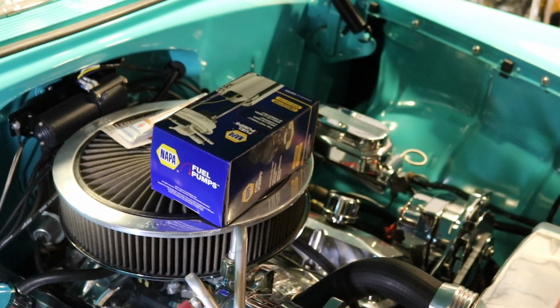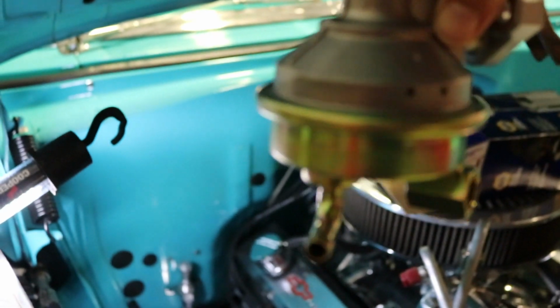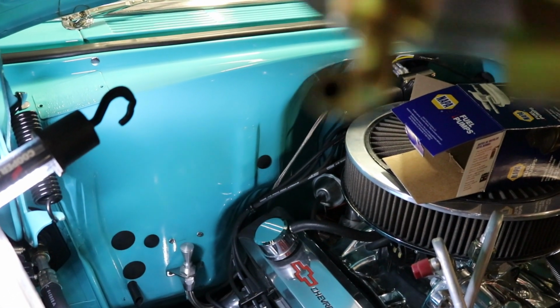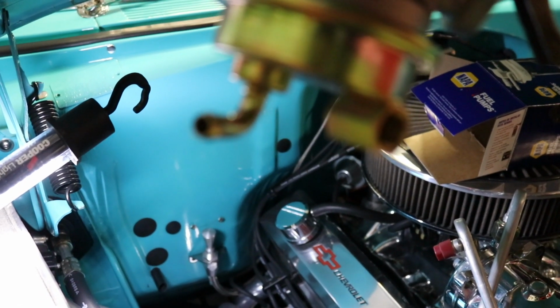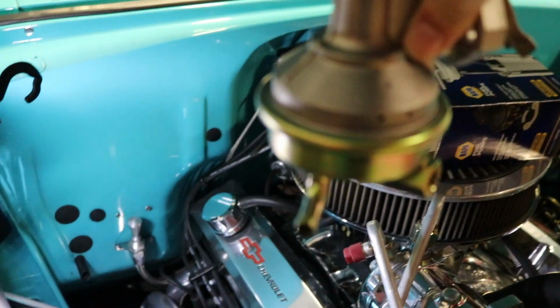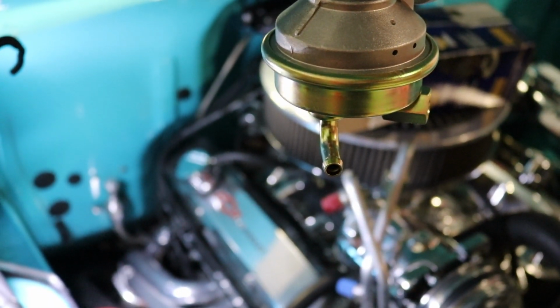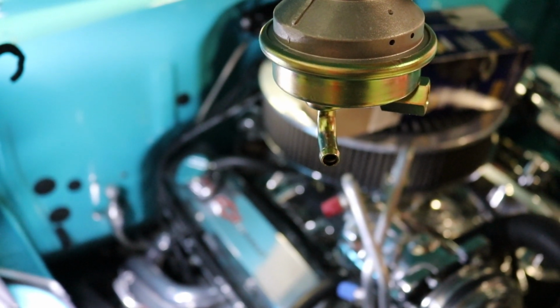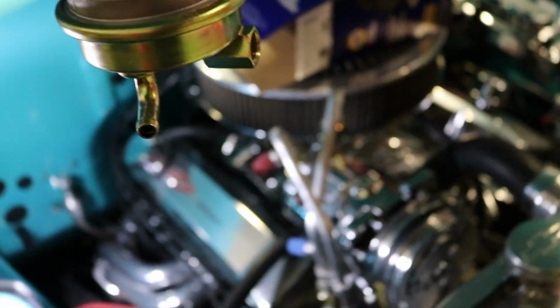So now I go searching. I went to AutoZone, O'Reilly's, nobody had it, and finally found the part at NAPA, and I'm going to be putting that on. If you can see, this is the way the fuel pump sits on the engine. You can see the inlet, the round connection, and then you've got that other bigger connection coming out. I don't know why that's not focusing. But it is in the wrong orientation. So if it's sitting on the engine just like this, you can see that the inlet is coming out towards the front passenger headlight, and the outlet is essentially pointed straight at the radiator.